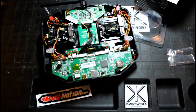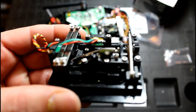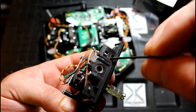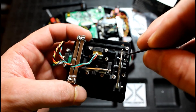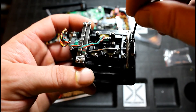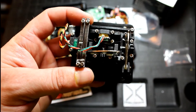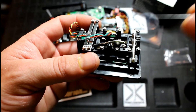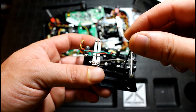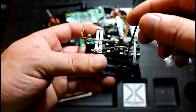Now, one thing I should point out — if you want to adjust the tension of the springs, down inside this little hole there's a little cap screw that will run this block up and down. When you run the screw in, it's going to loosen tension; when you run the screw out, it'll tighten and add spring tension. That'll be for your pitch axis. And for your roll axis, again for mode two, it'll be this block here, same thing. Set the allen down in there, tightening it — turning it clockwise will decrease tension, and counterclockwise will add tension to it.